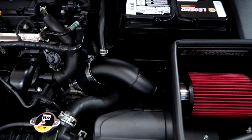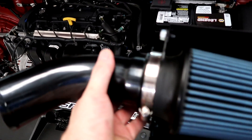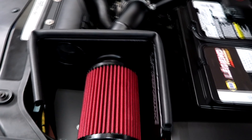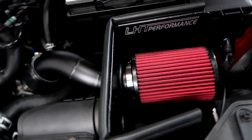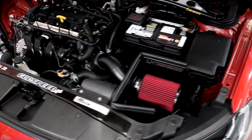The new intake is done. It has a full three-inch pipe going into a three-inch filter. This is a two and three-quarter expanding to three inches here, so we've got a little more airflow. The box seals off the engine heat and utilizes the little scoop that routes down into the grill, so there is some fresh air there. We left the bottom of the box open to access cooler air, put a seal on the box that just touches the hood to keep heat away, and ran a seal around the intake pipe — that should keep air temps quite a bit cooler.